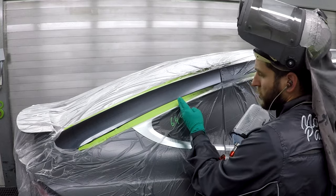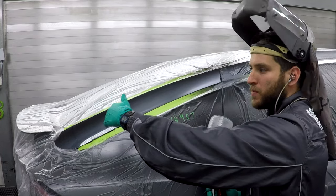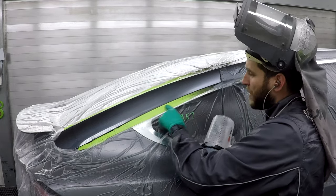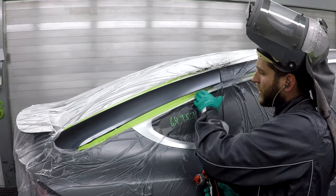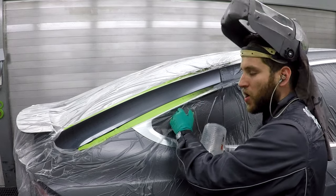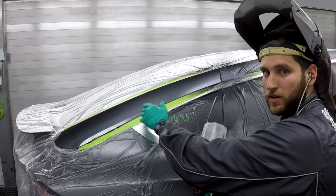I'm going to cut out the clear coat right here. You want to give yourself as much room as possible, because if you don't, you will not be able to blend it properly — you'll have base overspray and it just won't work. So what I'm gonna do is bring out the clear right up to here, let that flash, put a second coat on, and then I'll blend it over here. All right, let's do this.